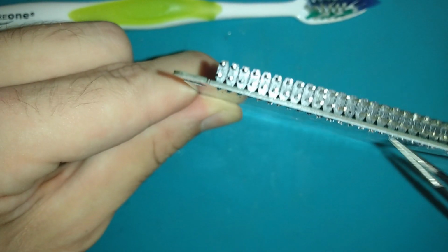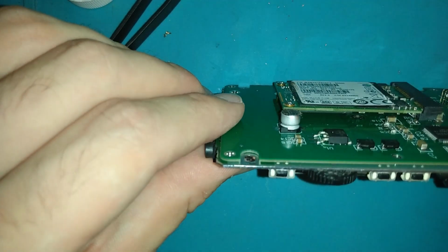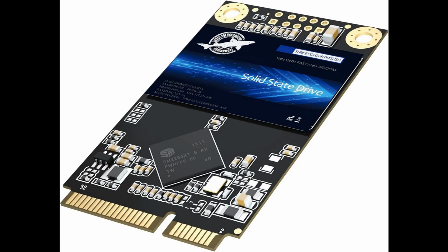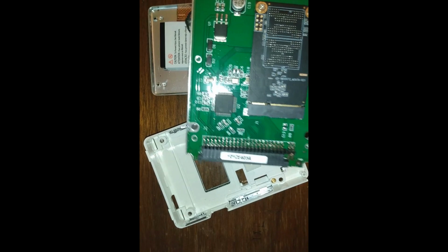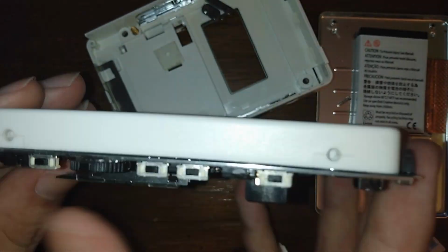Fortunately, my quick and dirty soldering approach was enough to get us the physical clearance we needed, and it works. The 128GB Samsung mSATA SSD I was using is very well worn, so I bought a 64GB Dogfish mSATA SSD for $12. The adapter I modified costs about $12 new. Compare this to the price of a real PATA SSD.